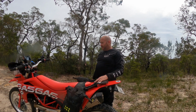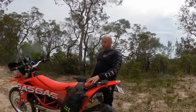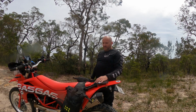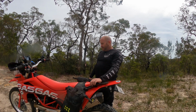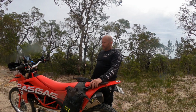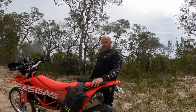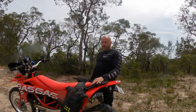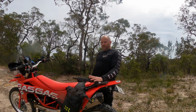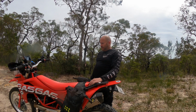But anyway, Suttners have done that. The good thing with the preload adjuster for the rear, I'm still waiting for the one for this bike, but they've put the spring and everything, so the sag has been set for me semi-loaded. The preload adjuster for the rear is adjustable on the bike just with an Allen key. So two or three turns and the bike's set up from this day pack to fully loaded like you're going away for a trip. Anyway, I hope that explains it a little bit better. If you want to know something, shoot me a question and I'll always reply to you.